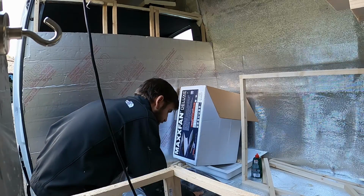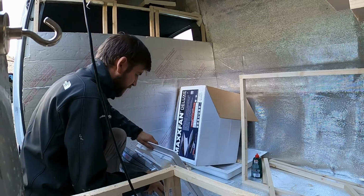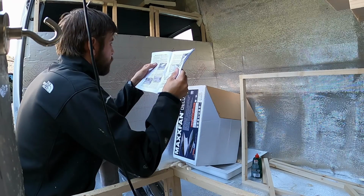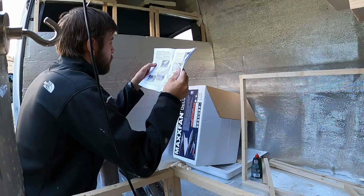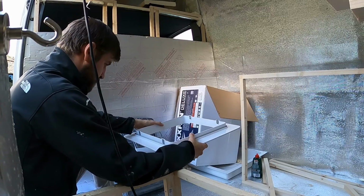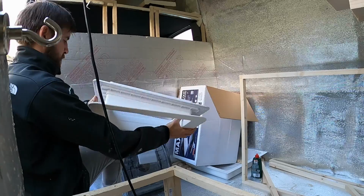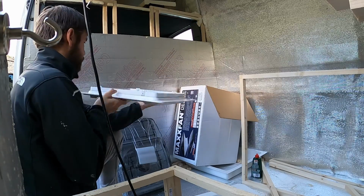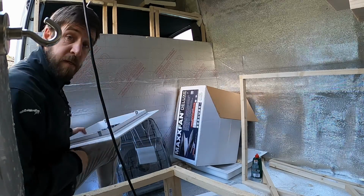The metal clips must be facing the side of the vehicle. So there are some metal clips here, you can see those. So they face the side, obviously, that's where they are at the moment. The roof receiving flange must be centered in the roof opening with the metal clips facing the side, not facing front or rear. Side. So that's the widest point, I think. Right then. Let's find the middle of the roof.